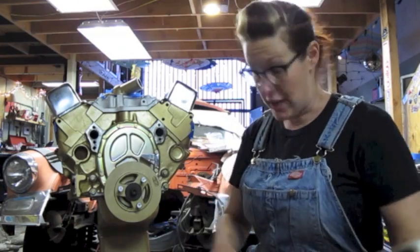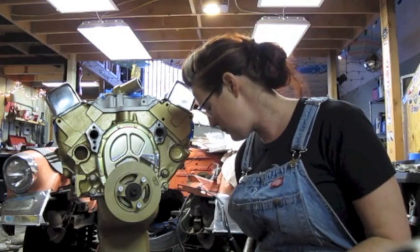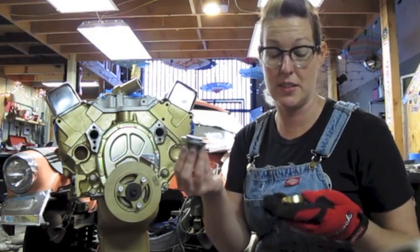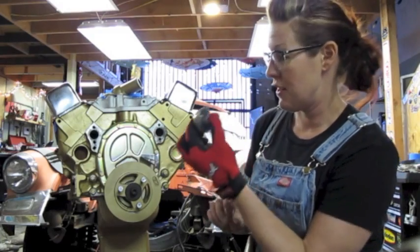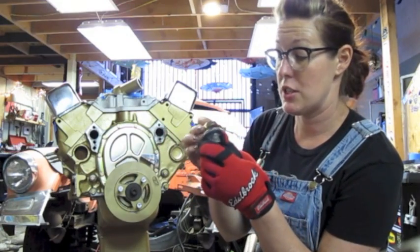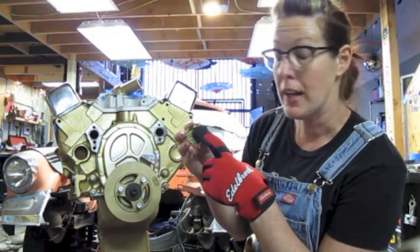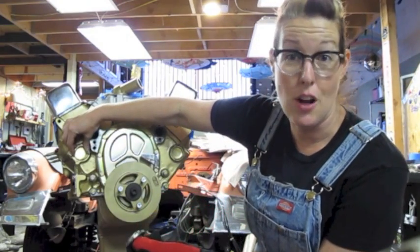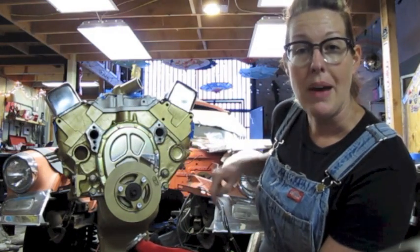And then we've been putting them back in. You could just hammer these in, but they do make a special tool for this. It looks like this and comes in different sizes — there are different sizes of freeze plugs. This has a little inlet that fits really nicely so you can get in there and get your freeze plug fitted and surrounded. This is better than a hammer because it evenly distributes the pressure around all sides, so you're not damaging it. My husband also says that it keeps you from over-installing the freeze plugs — you don't want to push these in too far. You basically want them flush with the outside of your engine block.